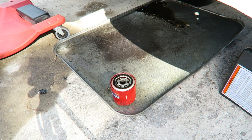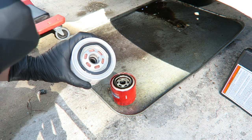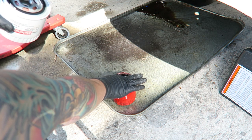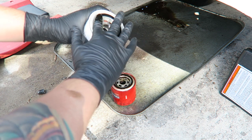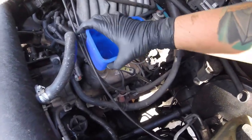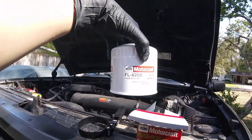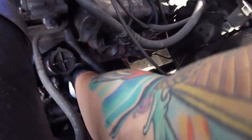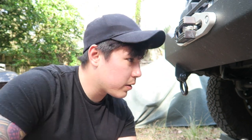What you should do is take some new engine oil and rub it on the gasket surface, but I just take a little bit of the oil out of here — it's never done me wrong, it'll work just fine. Never want to put those oil filters on super tight. You just want to hand tighten them as much as you can, and then I like to go in there with the oil filter wrench and give it about an eighth of a turn. I also have a magnetic oil drain plug — I inspect it, and it looks fine to me. Nothing crazy.